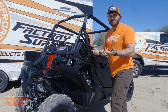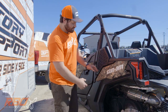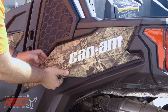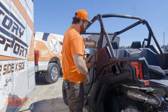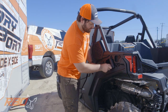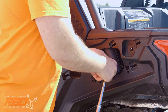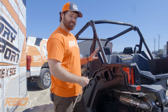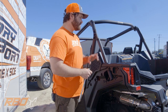Now move to the other side and do the same thing. On the driver's side, take this panel — it doesn't need any tools — start on one end and just gently lift towards the other end and this panel will pop right off. Set this to the side. Grab the 13 millimeter socket and take out this bottom bolt. While removing it, note that you don't need to worry about your roll cage springing — this down tube is more for aesthetics and is slotted at the bottom.